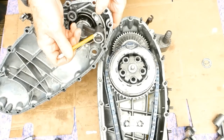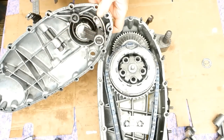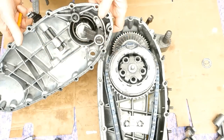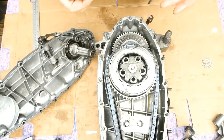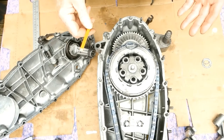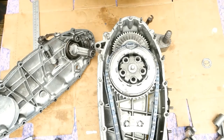The height from the teeth to the rim is now 35.4mm. I have 1.6mm of clearance between the teeth and the cogs. If I add a 0.5mm gasket, I have 2.1mm of clearance between the teeth and the cogs. Add the 2mm to mesh with the cogs — 4.1mm of upward travel for the piston, 24mm of travel for the pedal.